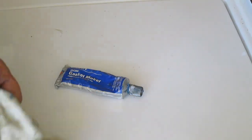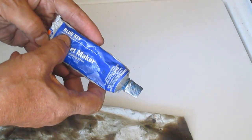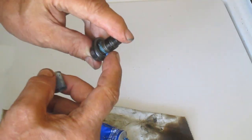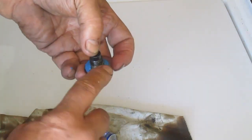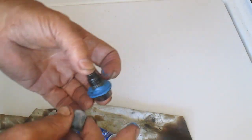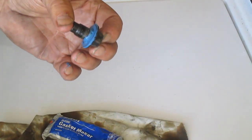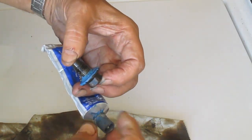What I do — not everybody does this — here's your drain plug. I use this blue RTV gasket maker. You don't have to do this, I just do it because I don't want it to leak. I just put a little bit all the way around here, not much. That's enough — just put a little bit there, wipe the rest of it off. I'll let this dry for maybe ten minutes and then I'll put it on. Some people do it, some people don't — I just do it. My car.